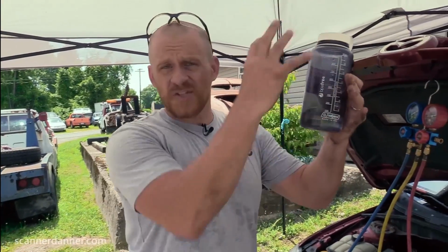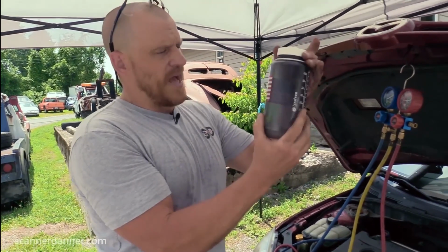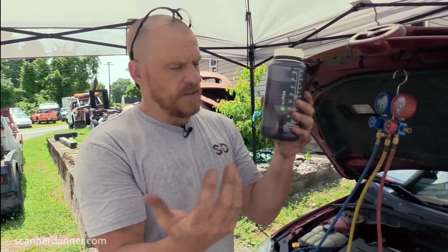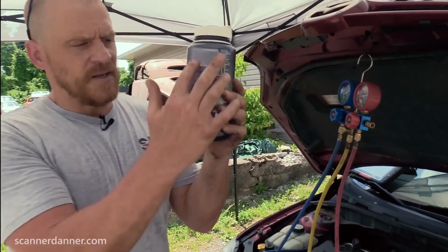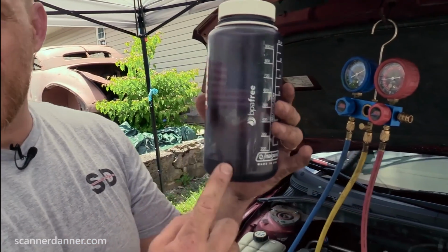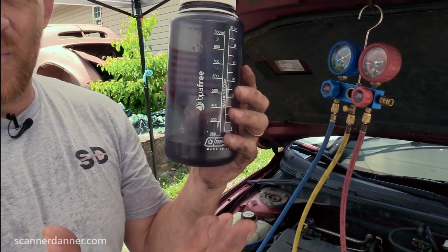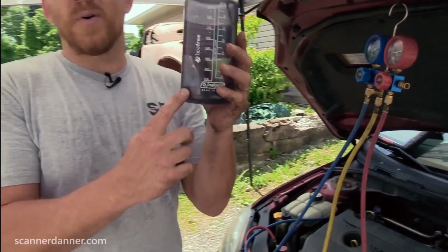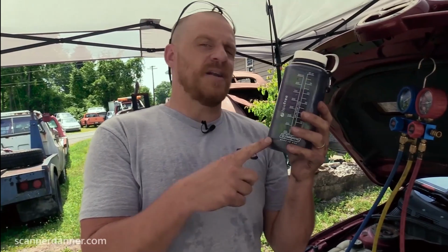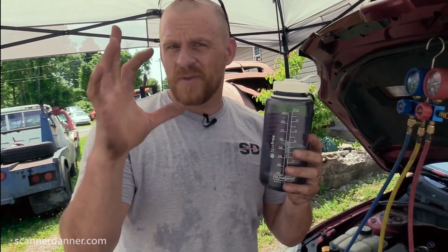So in a sealed chamber, if you picture this sealed chamber as our R134a refrigerant, there's a mixture of liquid at the bottom, vapor on the top. You picture this container, it has liquid refrigerant in there. How can we have liquid refrigerant in an environment where we're at 90 degrees? This should all boil off. If this refrigerant boils at minus 40 degrees, how could it possibly be a liquid? Look at a butane lighter, it's the same thing. You look at that liquid in the lighter, it has a negative degree Fahrenheit boiling point.